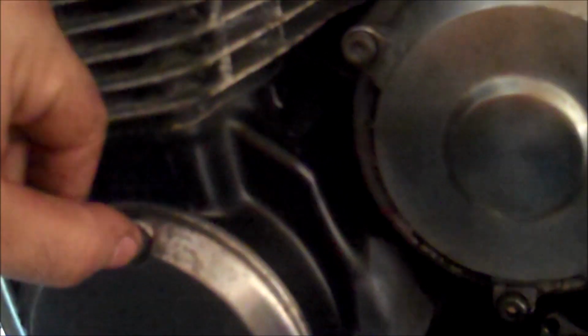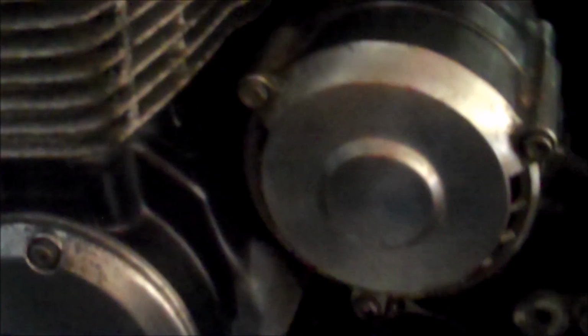Similarly, depending on the setup of your motorcycle and the different configurations of it, your gas might actually leak into the motor, then go down into the sump, and leak out as a mixture of gas and oil. And it will look like a massive oil leak, and this is why I mentioned you have to really touch and smell these fluids, because it looks like a massive oil leak, but really the problem is not an oil leak, it's a gas leak. And I'm going to cover that a little bit more when I talk about oil leakages.